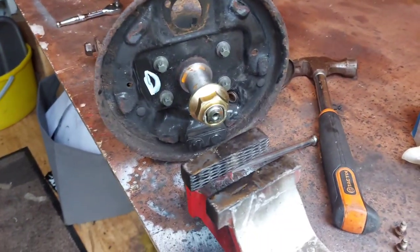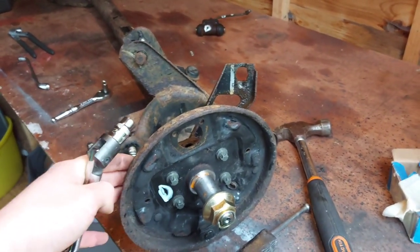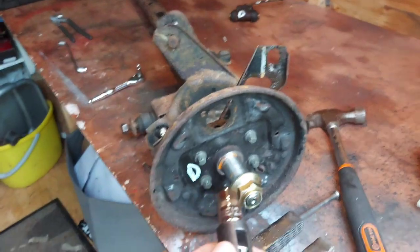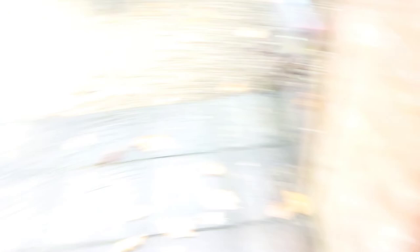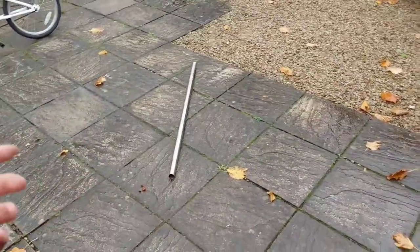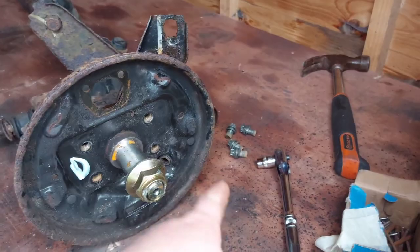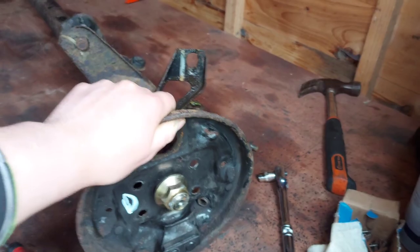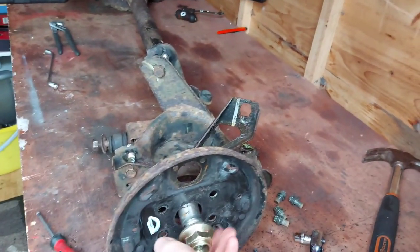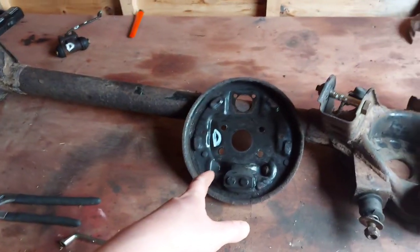With the brake cylinders out, we can move on and remove these plates. These are an E12. Those four were on really, really tight. I had to use that bar, put the axle on the ground, step on it, and use the bar with the E12. Now I've broken all of them loose and we can just ratchet them out. All four bolts are out and this just popped out — needed absolutely zero persuasion. I'm now going to do the other side.